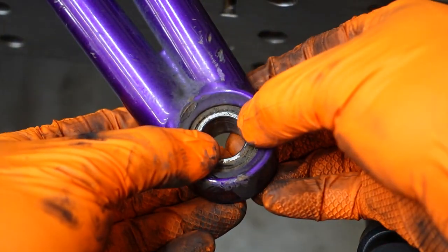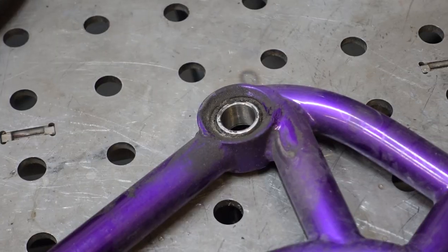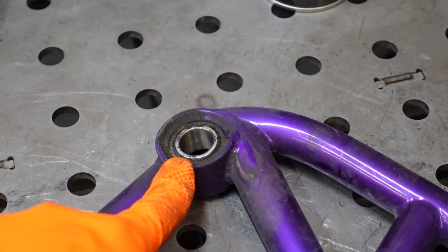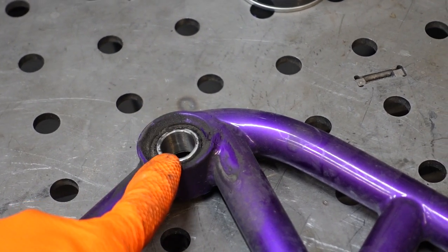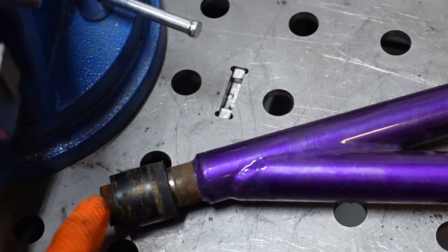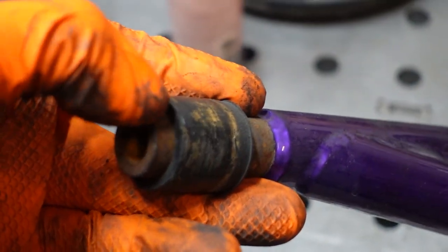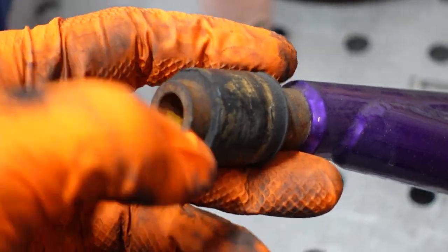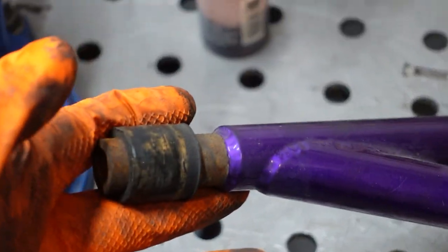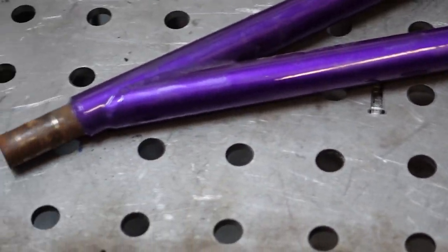It seems this ball joint is extremely loose. There's all that play. The inside one, even though it's dirtier, maybe by having old M50 oil landing on it, it kept it well lubricated and it didn't wear, but I'm still replacing it regardless. And then we have this little black bushing here that I was gonna have to remove. I'm probably gonna try to polish this part again so it slides in and out easier. So let's take care of this thing somehow. I'm just gonna pull this out of there, maybe yank it or break it or something.